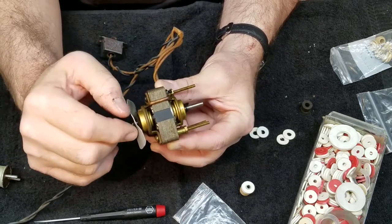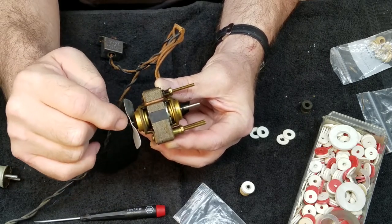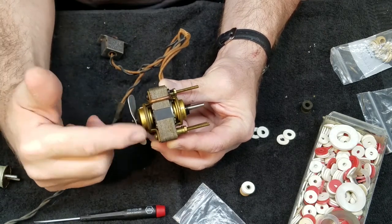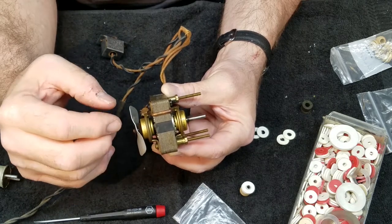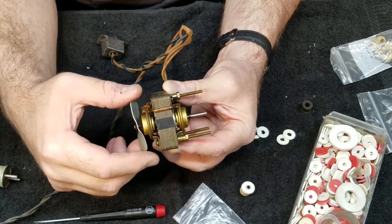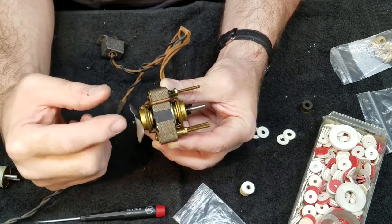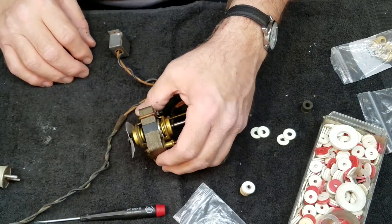Those felt washers are intended to be a storage place and dispensary for lubrication. What you do is put a drop of lubricant - maybe two drops if it's really dry - a drop of machine oil. I use Singer sewing machine oil on each of these discs. You spin it a little bit, and the idea is that the lubricant will wick through the disc and ultimately wick down to the shaft as the shaft consumes that oil. And then this motor is ready to go back into the record changer.